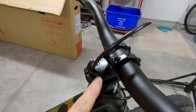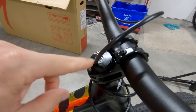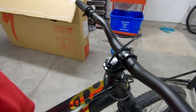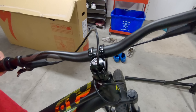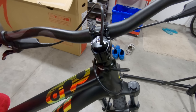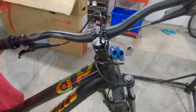The other thing we thought about was taking a tube cutter and trying to shorten the fork maybe a couple millimeters, but you do have the star-fangled nut inside there. So we're going to try the hacksaw trick first. Honestly, I'm a little disappointed with Specialized — I'm surprised they'd have a fork cut a little too long. Major oversight in my opinion.